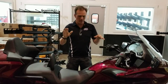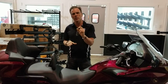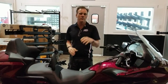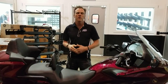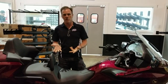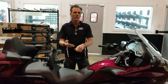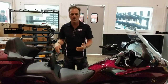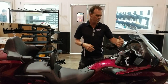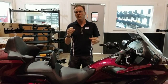The correct way on any single monoshock rear suspension bike is to lower the shock absorber itself internally. Most stock shocks on Gold Wings and bikes like this are not rebuildable, so your only option is to buy an aftermarket shock. A company like ours will set the height internally to whatever you need at no extra charge while building the shock. You get a better shock absorber that functions better under all conditions and get the lowering accomplished at the same time. Bottom out will be in the same location and the bike will be as safe as it can be. For the 2018 Goldwing, the front shock is completely unserviceable and non-rebuildable — the only option is to replace it, and again we can set it up lowered internally.